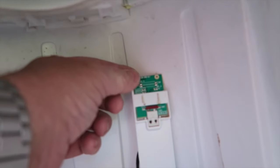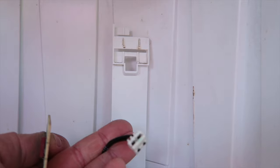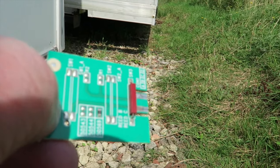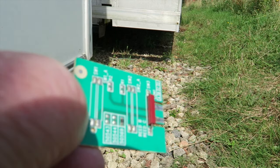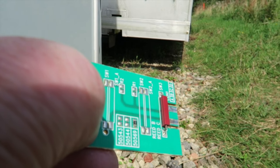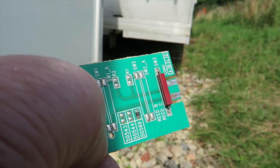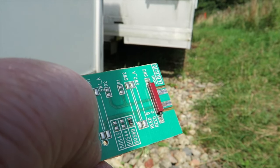Removing the actual board itself — it's very simple, it's got a connector on the end which is a wire, and the circuit board just comes out. Pulling it out into the nice sunshine, you can see that what we've got is a little red block — that's a magnetic sensitive switch called a reed switch. They're very common in door alarms: you'd find a magnet in a door and the actual switch in the door frame. That's how old-fashioned door alarms knew whether a door was open or closed. Same principle here — a magnet rubs up against the reed switch, creating the circuit, which switches on the LED on the toilet.